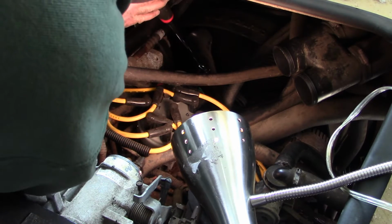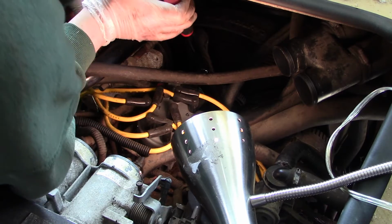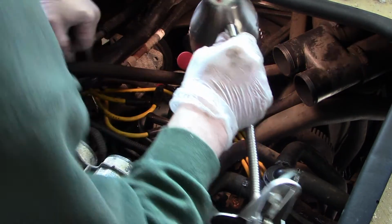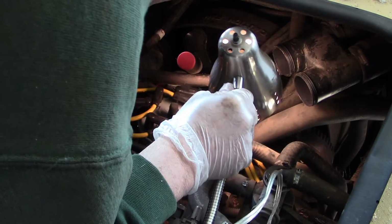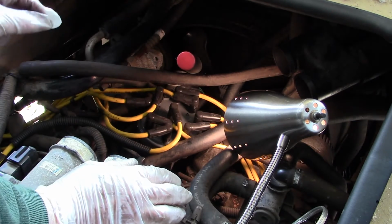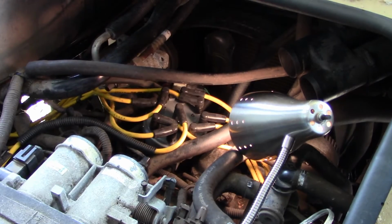Love it. Oh, I struggled so much with that other belt that was too short until I realized this is just not the right belt. So now I'm on. I can slowly release the tension on the tensioner, and that belt is in place. Now make sure you're in the grooves of the pulley correctly in every spot. Take a look from below also, and I am going to go down and remove that piece of Gorilla Tape that I had holding the belt in place down low. And that will be the inner belt successfully installed.